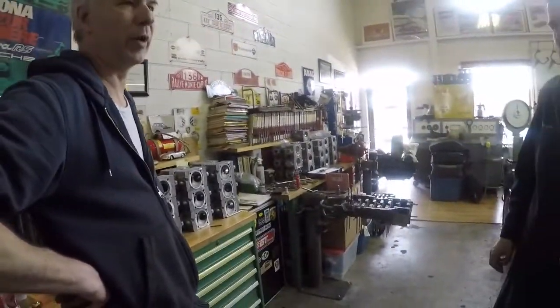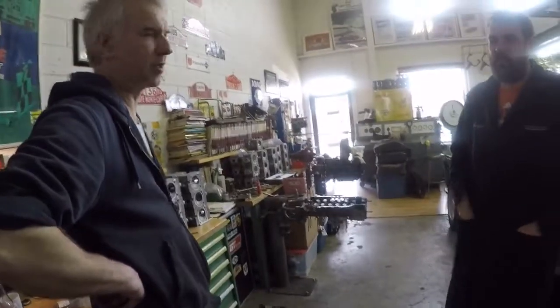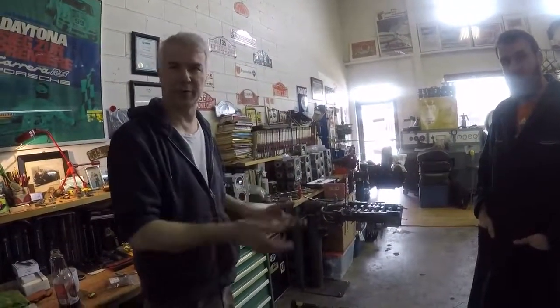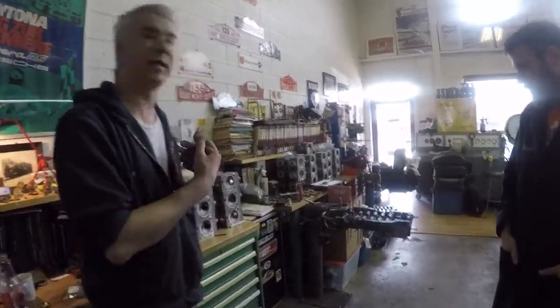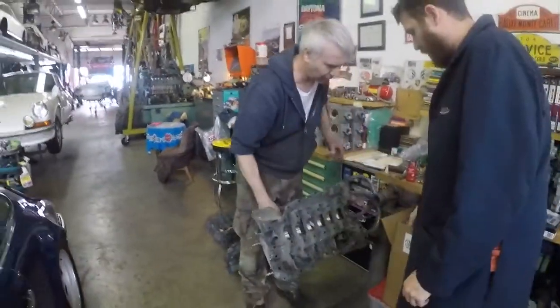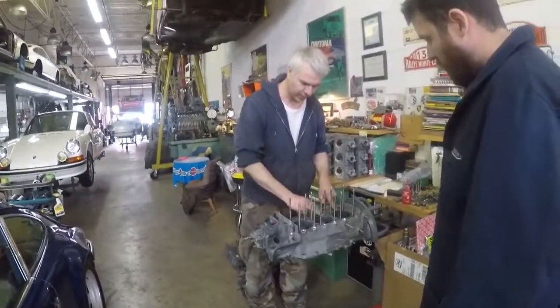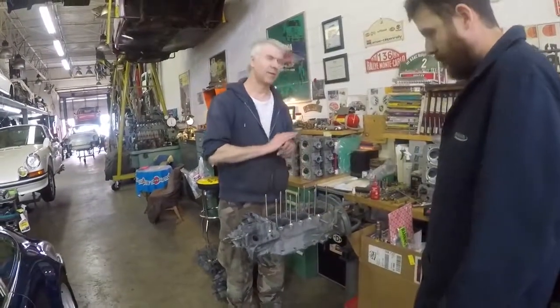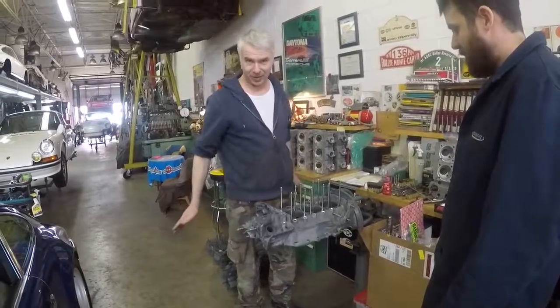This was a California motor with thermal reactions — thermal reactors on the exhaust. These motors are typical: they overheated, they didn't breathe properly, and that fatigued everything in the engine. So you had cylinder head stud cracking, breakages, warped spigots. This whole section was remachined. Everything was stressed out on this motor.